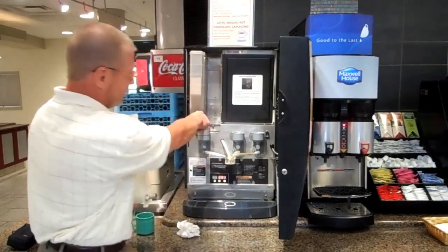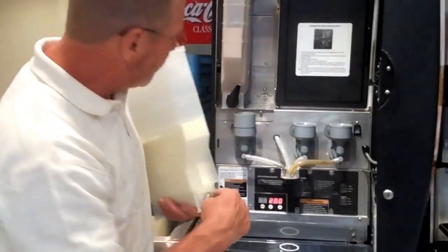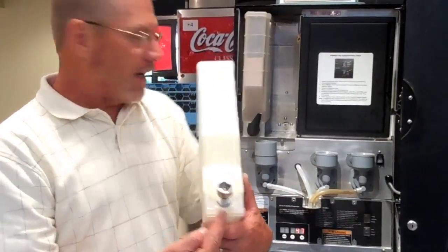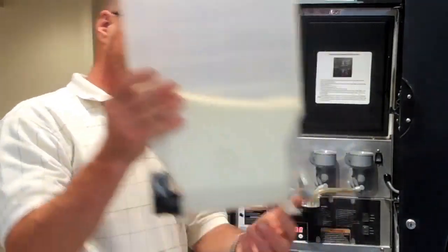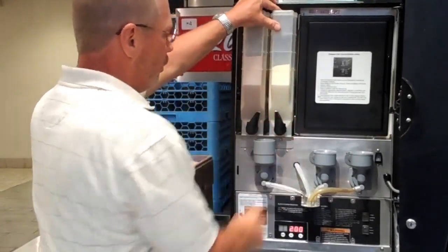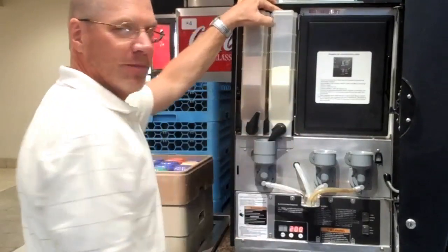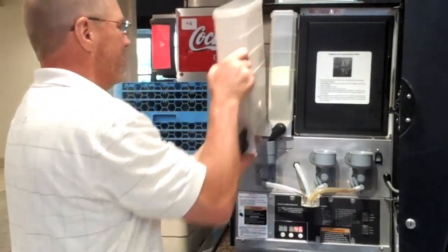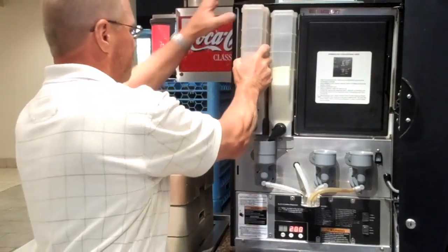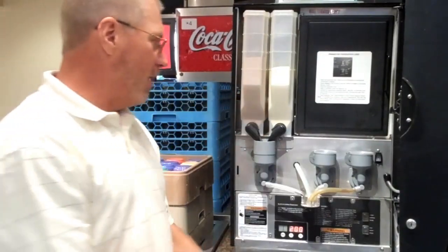When you put it back in, see that little propeller in the back? That fits in the back of this. I always try to position this in the same position so it goes in. You'll notice a little slot on the bottom, and on the bottom back there is a screw that sticks up — make sure that slides into that screw when you push it in. You'll know when it's in place because it will drop down into this little plate. Then you simply turn these down. Hot chocolate is done exactly the same way — same little auger, line it up, push it into the screw, make sure it's dropped down into place, and then turn that down.